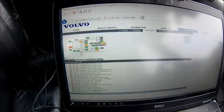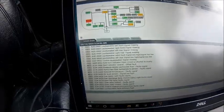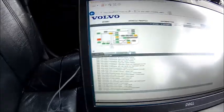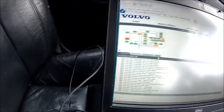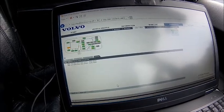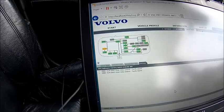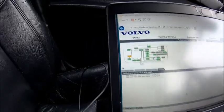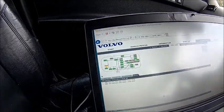So we're connected. We got 12.2 volts, I've got a charger on. This was the old error list. Let's see what we have now. We have 6661 is number one, and 6663 is cylinder number three — faulty glow plugs. Looks good to me.